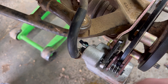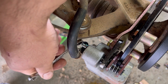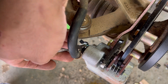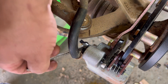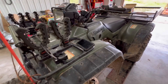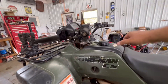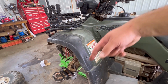On the right side over here, I should be able to get this by myself. I've got the brake pumped up. I did manage to get this side by myself by simply coming in here, turning the handlebars all the way this way and pumping it up, and with my left hand breaking the bleeder loose and tightening it. So I was able to do it by myself.